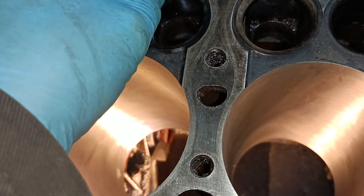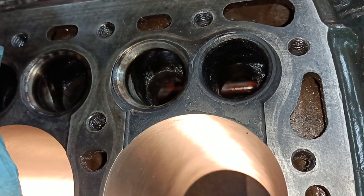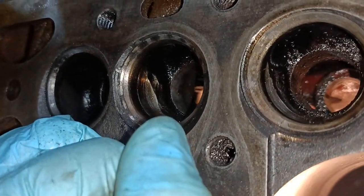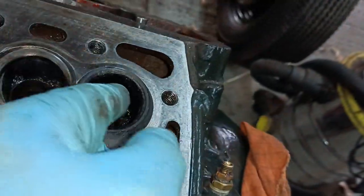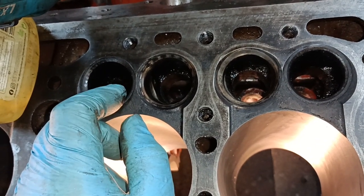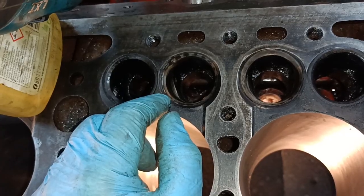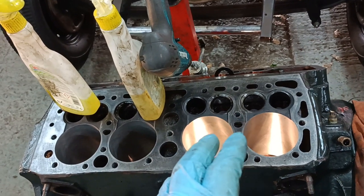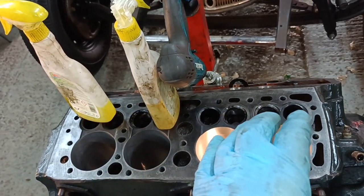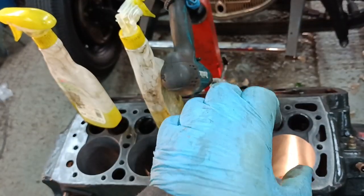What I have got here is some sort of weird pattern on the valve seats. I didn't do a very good job of the valve seats when I did them before. I was struggling with the cutters, to be honest. And I believe this engine does have valve seat inserts on every valve, because I was putting forward a statement saying that French motors have valve seat inserts, and other people who do know a lot about it were saying no they don't. And I was thinking, well, I'm sure mine did, because I struggled to cut these seats. And I think the result of that conversation was that some French engines had valve seat inserts put in during rebuild as necessary. This engine has them across the board. They are all inserted. So this engine, when it was rebuilt, had a full set of valve seat inserts.